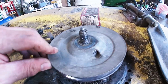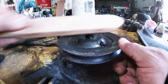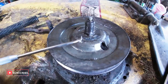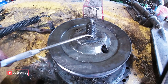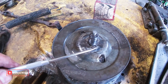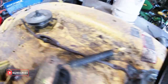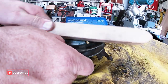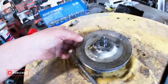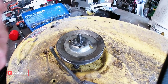You can see — it's a bit hard to see when it's not clean — but you can see there how this has got flats on it but the pulley has shifted and it's not on the flats anymore. There's a corner, there's a flat — it's just kicked around 10 or 15 degrees to the side. That other one's even worse and it's loose — it just spins on the spindle. That'll be giving slip to the belt and causing the belt to heat up.